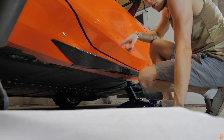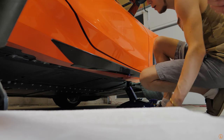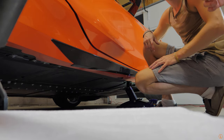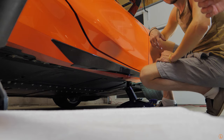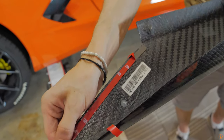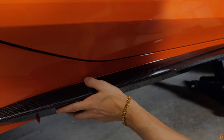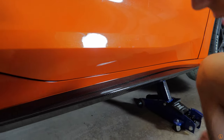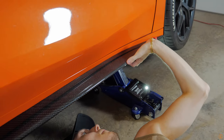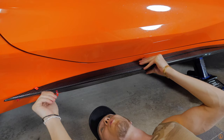Instead of doing the first rivet right away, we're making sure the adhesives are exposed. We're going to pull them all the way off. Then once the adhesive is ready, we'll push it against the panel for a few minutes — it's warm enough so it'll hold. Then we'll do the rivets at the end. We got all four adhesive tabs folded over so they're peeking out. Let's put it on the vehicle — we just have to make sure the holes are lined up before we start peeling. Checking underneath — this one's looking good. We'll show you guys a view of the underside at the end. They're all looking good.